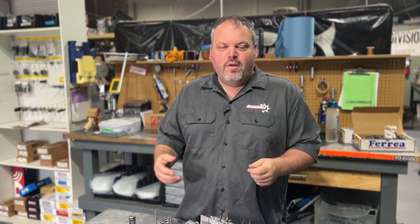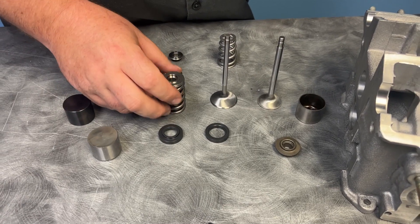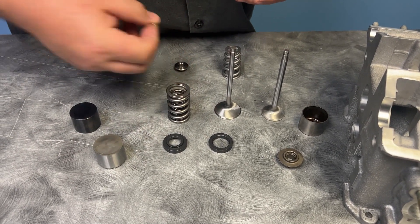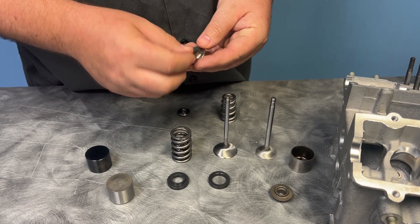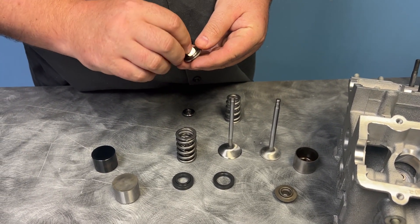But now we're not in control. We're not in time. The bucket doesn't sit on top correctly — it doesn't have the right lash because everything's out of control, everything's out of time, and the cam is striking the bucket instead of rolling on it. As an example, all RB26 valve trains available from the aftermarket have the same provision for the shim.